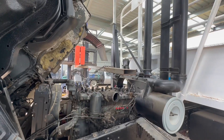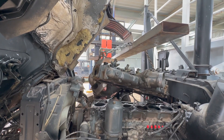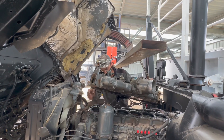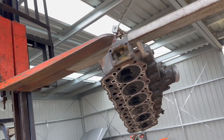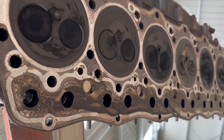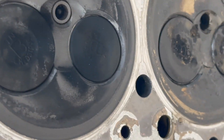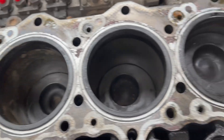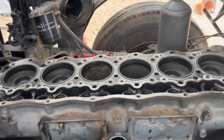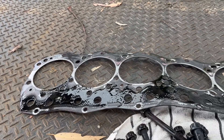Put the head chained up here and got it down. It actually looks really good — I've still got it hanging from the forklift. I don't see any tracking or anything. A little bit of carbon build-up, the valves all look good, there's no obvious cracking or anything, and there's no tracking where water's gotten in. All the Welsh plugs underneath look good — really good. Coming over to the motor, I can still see cross-hatching, so it's actually really good. It's just a matter of getting them out and seeing if the seals are all good. There were no obvious signs of tracking that I could see either.